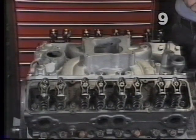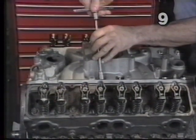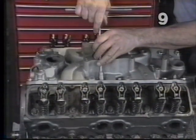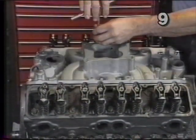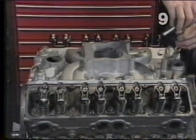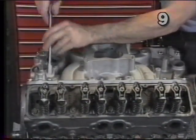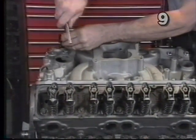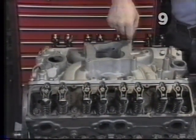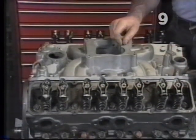Once you've started all your intake manifold bolts, take your wrench and just snug all of your bolts. You want to do this starting from the center of one side, move to the center of the other side, moving out and across. What we're trying to establish here is a pattern that goes around the manifold and works from the center out. This way we won't warp the manifold and we will tighten our bolts correctly.